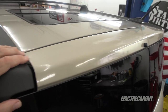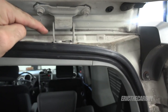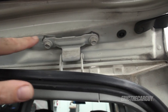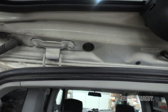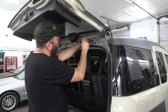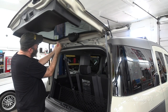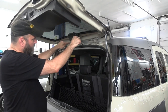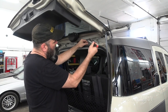Job one is going to be to get this thing lined up where I want it — it looks like it needs to go in a bit more on this side. I wasn't sure if somebody was moving the fasteners from underneath or up here, but judging by these witness marks, I say that's where it went wrong. So I'm going to loosen these, push it back, try to push it into position, and then tighten everything down. These are 12 millimeter. I'm going to try to get them to where they're a little bit tight but loose enough where things will move, so I can just sort of knock it into position. Very careful because every time I move it closer, it can come into contact with the roof — so I want to do this slowly so I don't create more work for myself.